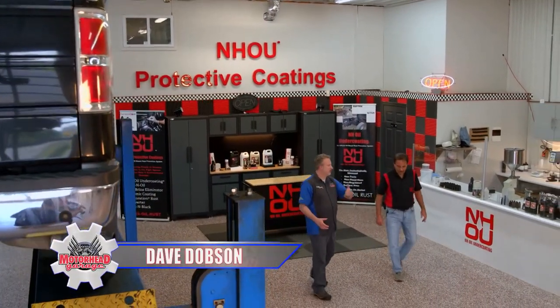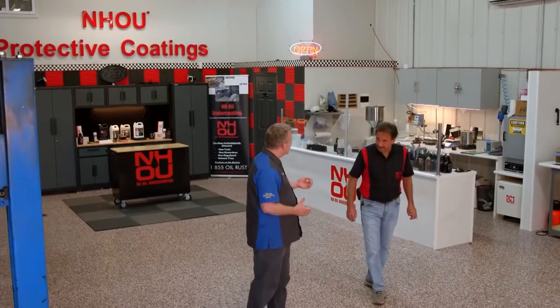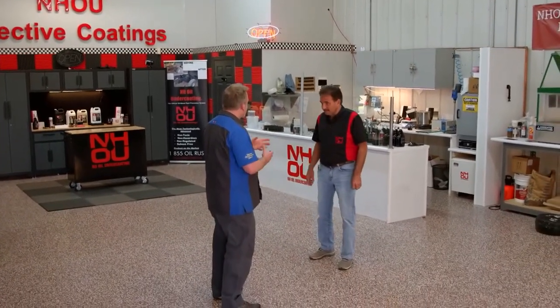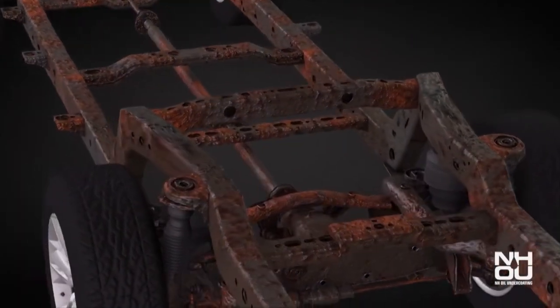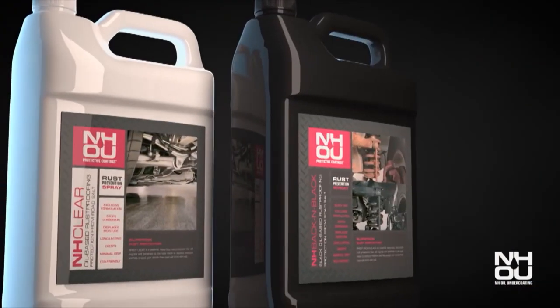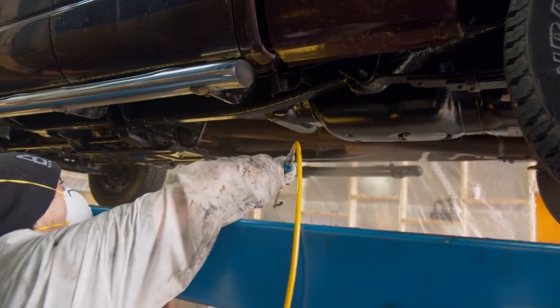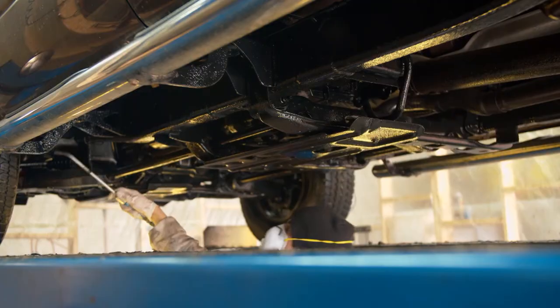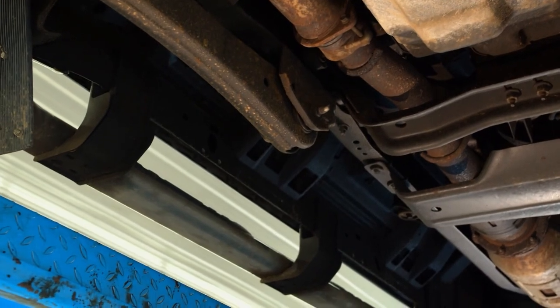The automobile was invented at the turn of the last century, and over the course of over 100 years, rust is still the enemy. Nobody's really figured out how to address it until now. What are you guys at NHOU doing to combat rust? Rust has been dubbed the longest war — it's really difficult to beat Mother Nature, but what we do is slow her down. We mainly use an oil-based rust-proofing. The oil can go on brand new or over pre-existing rust. It does not encapsulate the rust — that only allows it to grow beneath the surface. This will actually go down to the good metal, displace moisture, remove oxygen. As long as you have product on your vehicle, you stop oxidation.